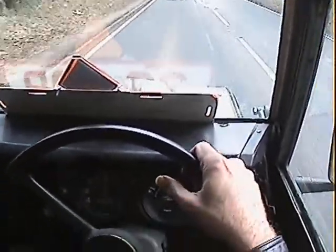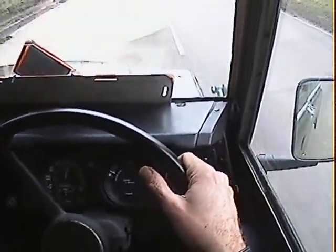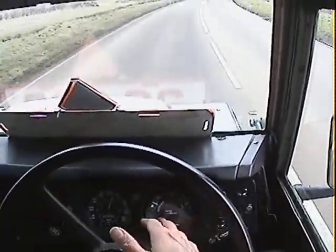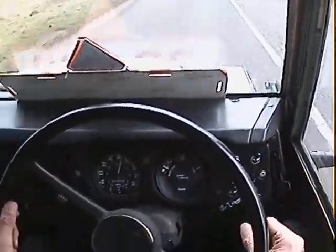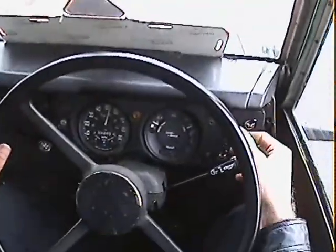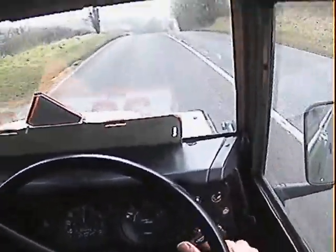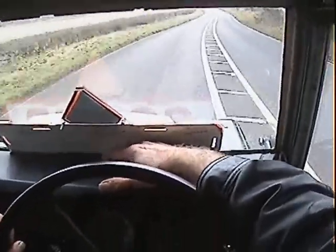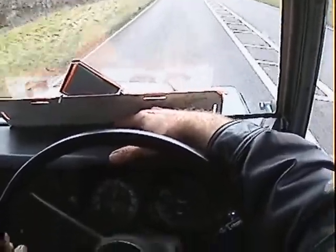Showing 67,000 miles — I've got no way of confirming whether that's genuine or not. But the speedo works, fuel gauge works, temperature gauge works, low pressure lights and charge light function as they should. I'm not sure about the fan switch — it's working on, but I don't hear the fan. I think it might be getting a dribble of air coming out, fairly warm as well.